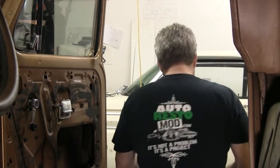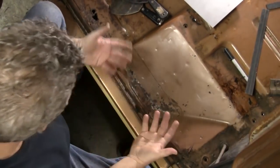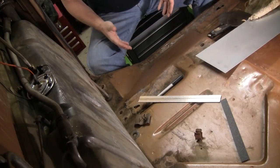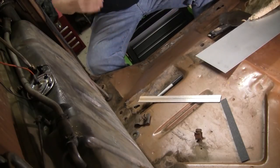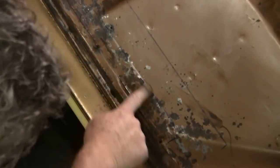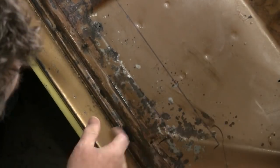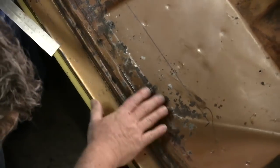I'm going to jump up and go over to the bench vise and show you how I actually made this piece. I'll do it for the driver's side to show you how we produced it. I'm not going to be building one actually on this side, but I wanted to go over what we've got going on and how to set up a template for one of these trucks or even a car — if you need to make a patch panel piece because you don't have the part or there's just not enough metal damaged to buy a full floor pan. Here's what we've got on this particular truck: this piece on the other side is rusted right along this line. I've seen rust on both the driver's side and the passenger side of these cabs.